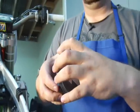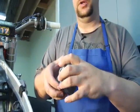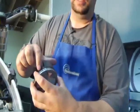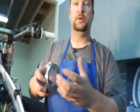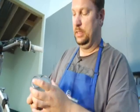And the oil rings, there's 2 oil rings and then a seal ring. And what I like to do is put the openings across from each other, so you'll see one is here and one is there. Don't try to mix them up, it hurts the oil flow. So yeah, basically we're ready to install. So line up your ring. I always put it at the back.